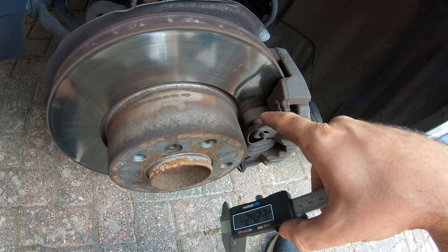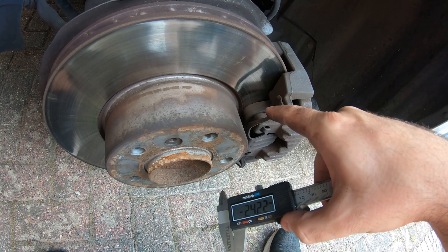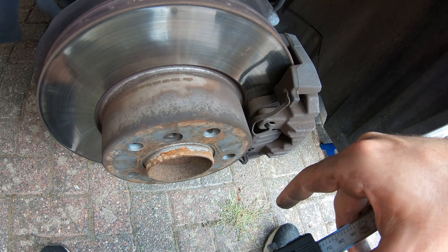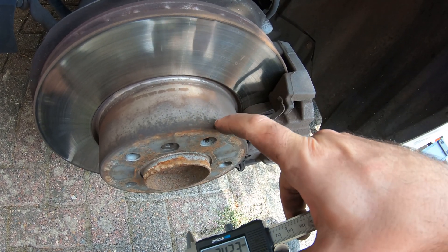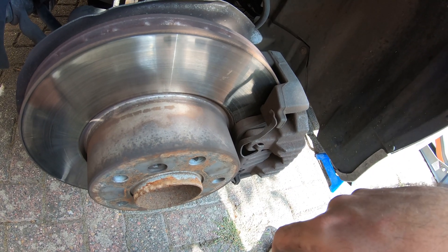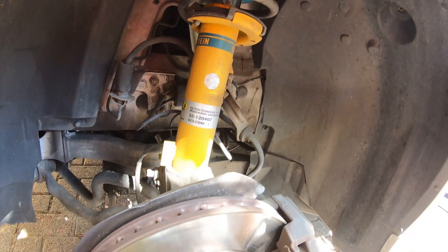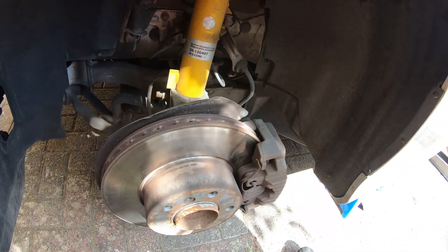What I've noticed on the E90 is the car goes through front rotors a lot faster than the pads, but for some reason the rear pads go faster than the rear rotor. Maybe there's just better cooling on the front rotors. This brake set has done about 30,000 to 40,000 kilometers and it's still really good — these brakes do last a long time. Everything looks good from when we did our suspension change. Check out those videos or other maintenance videos in the playlist below.